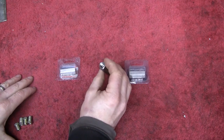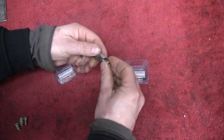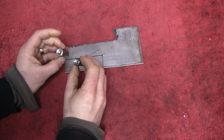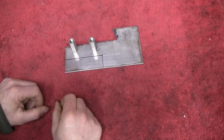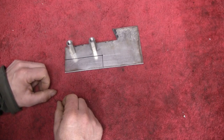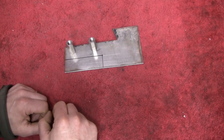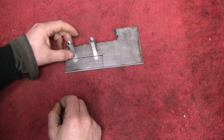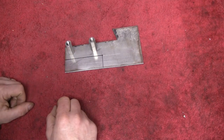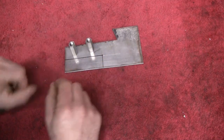To do that I've got a bunch of these stainless steel 3/8 by 24 inverted flare unions. These fittings are stainless steel and although shiny, I absolutely hate this stuff. Its only redeeming property is its corrosion resistance. Unless you're looking for something with terrible heat transfer properties, I see no reason to use this anywhere on a race car. It has a terrible fatigue life, it is impossible to cut, it warps its brains out when you weld it, and it blunts all your drills. But we're going to use it for these brackets because they're already stainless and I don't want to have to paint them.